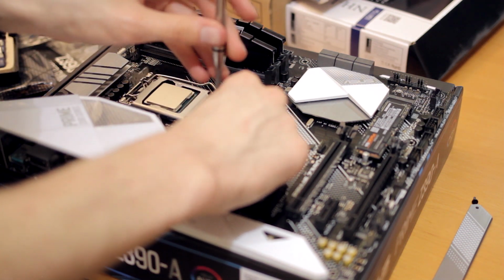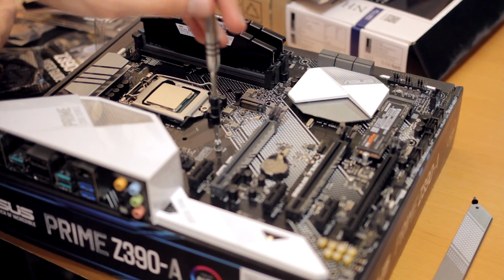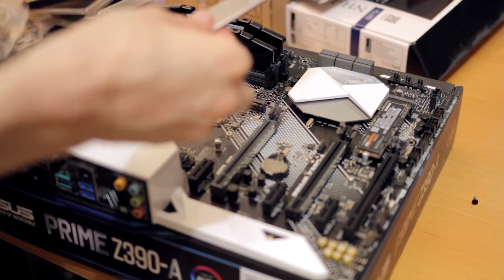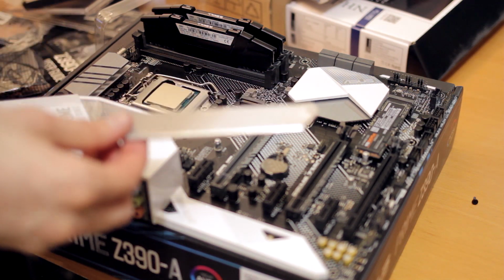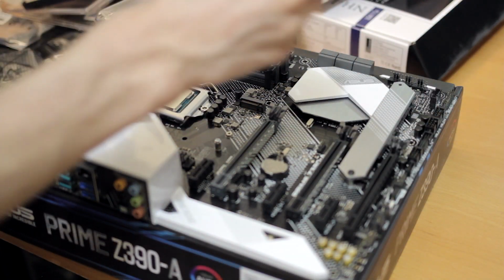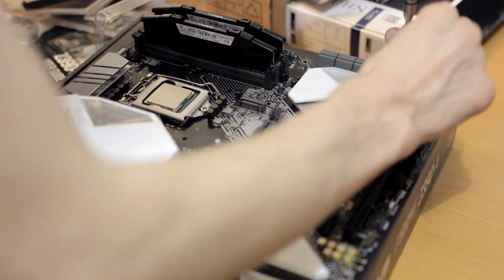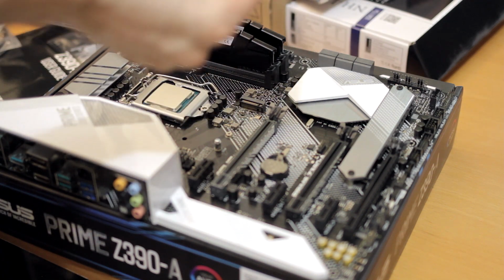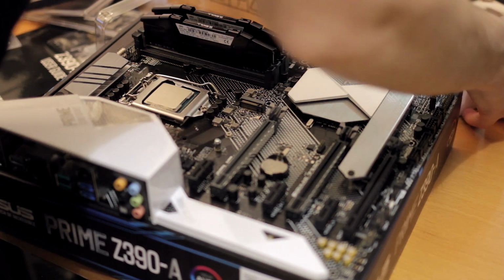Happens a lot. Another weird thing I found diving through the motherboard stuff is I found the normal cables. I found a fan holder, but I don't think it had a fan, which I find odd. I think it's for the VRMs. Looks like it just kind of attaches here and sits above the VRMs, here-ish? But that's an odd spot to put a fan. I'm in the mindset of it doesn't really matter, since it didn't come with a fan, and it's also a 40mm fan, which is not known for being the quietest. There's a lot of talk about them just failing, but I haven't seen it that much these days. You also get an SLI bridge, which is cool and all, except for the fact that it's the old standard, not the high bandwidth ones, which they're really pushing.